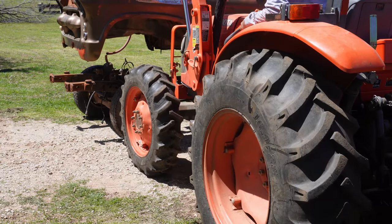I'm going to get the 1/2-ton fenders on there, and we'll see how that looks, but I'm thinking that cab mount needs to come forward. But be that as it may, I think that turned out pretty good. No cutting, no welding to lengthen the frame. Put in the trailing arms, and Bob's your uncle. In the end, there ain't a lot up here that has to be mushed too. You can see there's the shock tower. And I've kind of whittled it out a little bit to clear that, but that's not as much as I thought it was going to have to be.